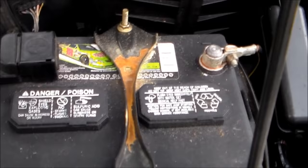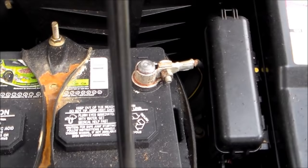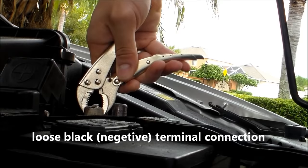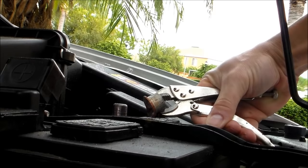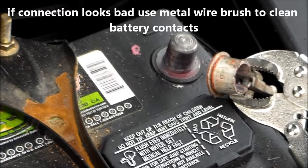You want to turn off the car first. I normally do TV repairs, tablet repairs, computer repairs, and Android stuff, but since this is my own van, I figured I'd show you and share it with you. What we're going to do is take off the ground cable and put it somewhere safe. You want to hold it off for about one whole minute — two minutes to be safe — and that's to hard reset the computer on your car.